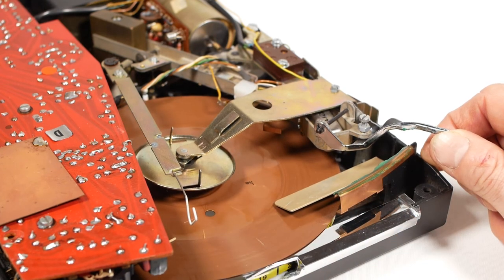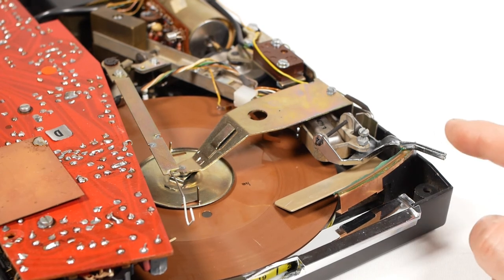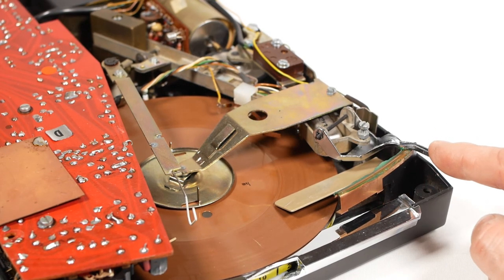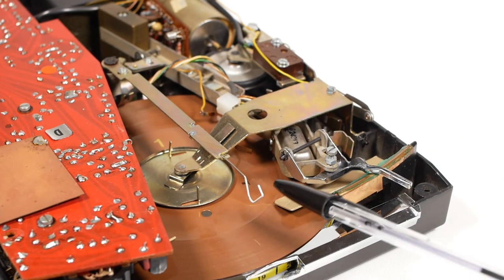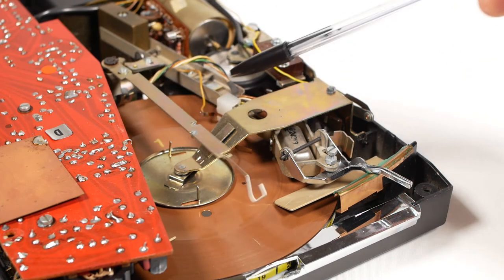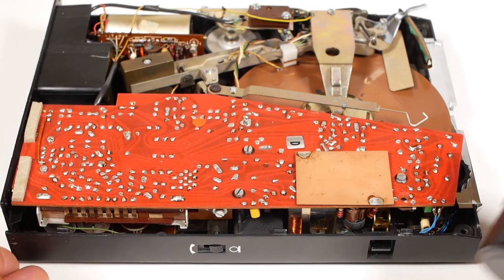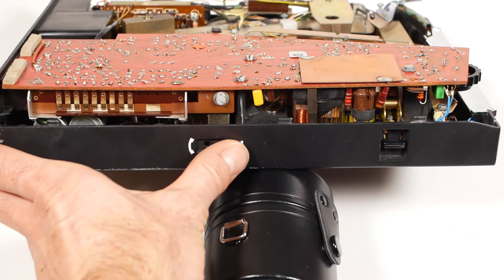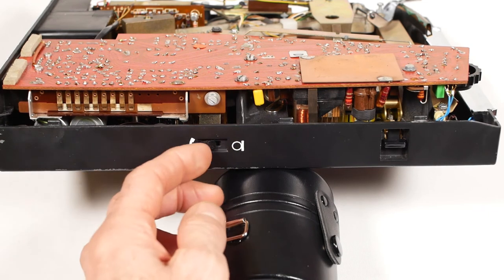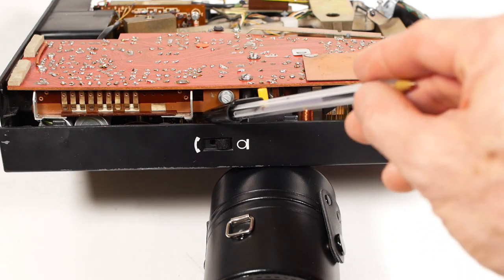Then when you lower the head, the hub centres the disc on the platen, ready for playing. The playhead itself is over here, and if you want to move the head to a different point on the disc, you gently press this lever, which raises the head and then you can move it to the position and drop it. The index marker is here, which is driven off a cam just back here. The main circuit board takes up the entire left-hand side of the machine, and if I raise it up a little, you can see the multi-way slider switch here that selects between the telephone input and the microphone input. And there are a couple of relays, one just here, and the other hidden behind the slider switch here.